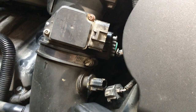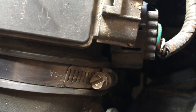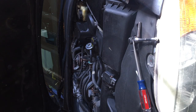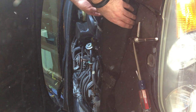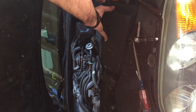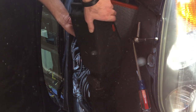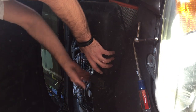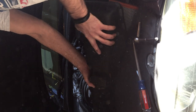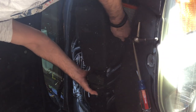This aviator clamp you can take off with a flat blade screwdriver, or you could use an 8 millimeter quarter-inch drive socket. Now I'm going to take off the air box — there are two clips right here. Pull back on the tab, let it disengage, and wiggle the bottom so it comes unclipped. I loosened the aviator clamp but didn't take it off all the way, because re-threading it can be a pain. Now I can pull this out and wiggle it as I go.